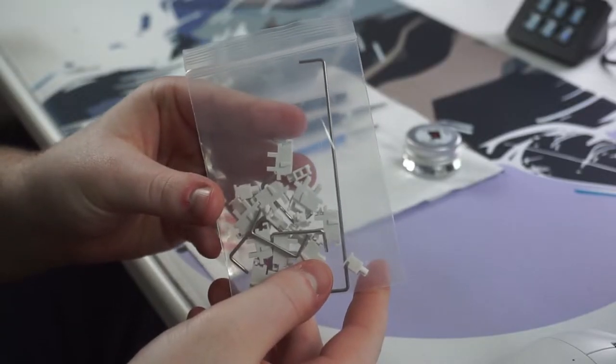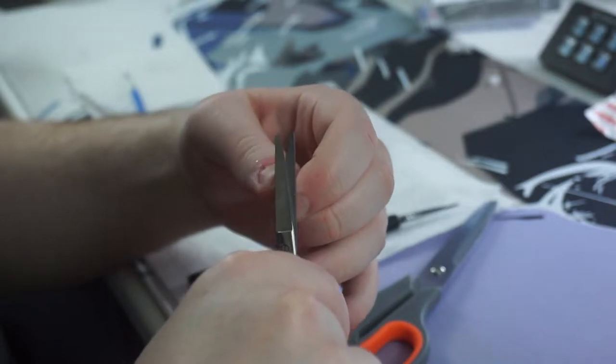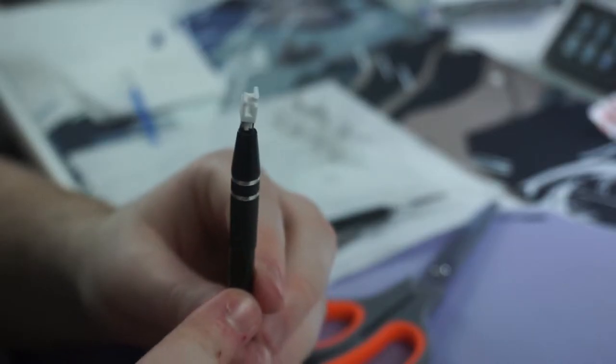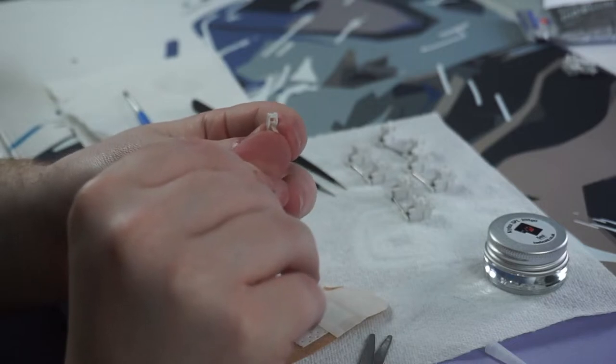Now, instead of holy modding every single one of the stock stabilizers, which, let's be honest, I couldn't be bothered to do, I picked up some Durock plate mount stabilizers, lubed the housings and stems with Krytox 205 grade 0, put some dielectric grease on the wires, and then I did holy mod the spacebar, but only the spacebar.